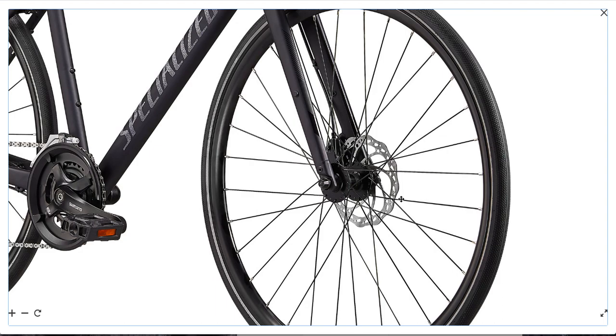Let's talk about the brakes — probably the best feature of this bike. Promax hydraulic brakes that are surprisingly strong. You may not have heard of Promax, but they are one of the biggest brake companies in the world and produce brakes for many other brands. These are probably more than you'll ever need. They're so good that while this bike is mainly designed for riding in the city, with the right tires you'll feel very confident on flat dirt roads and gravel. Being hydraulic, it does not need a lot of maintenance — maybe every 2-3 thousand miles it might need to be bled. Overall, you will be pretty happy with these brakes.